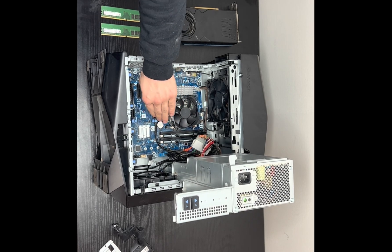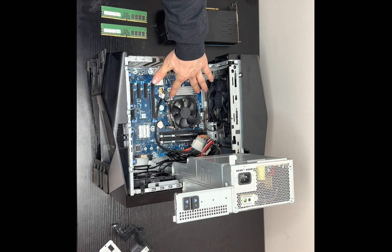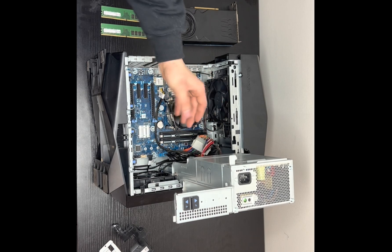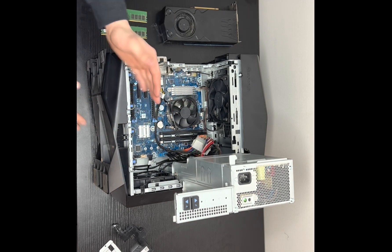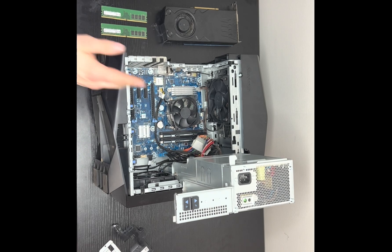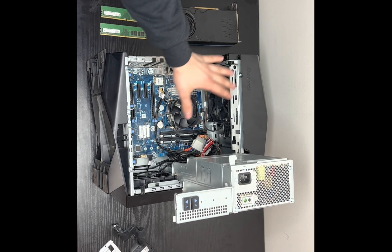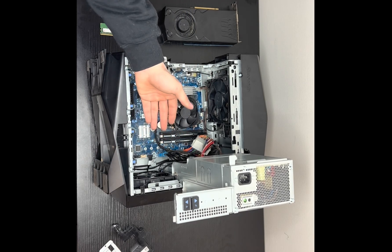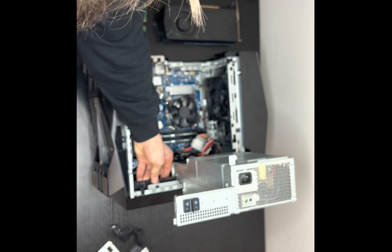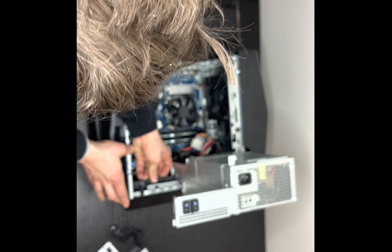Underneath here is your CPU cooler — this is where your thermal paste goes, underneath and on top of your CPU. To remove it on this model, there are screws on each side; just unscrew and it pops right off. Clean the cooler with alcohol and q-tips, then paper towel the rest. Also, every fan can be taken off — there's a clip here, push down and push forward and it comes right out.